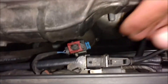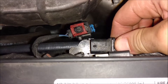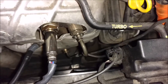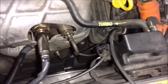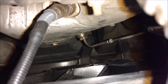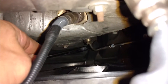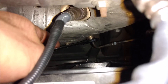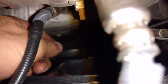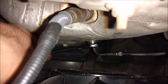Go ahead and get your finger under there — it's a little tight but slide it out like that. Then grab on the top and bottom here and pull this out. Now this whole thing is ready to come out, and we can go ahead and get our 17 millimeter wrench and loosen that up. I'm going to position my wrench over top of this nut here — just a little force, break it loose.